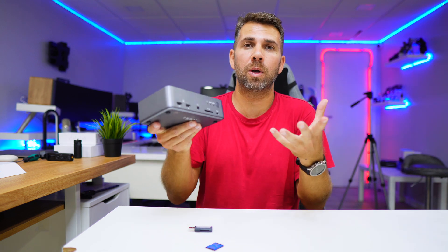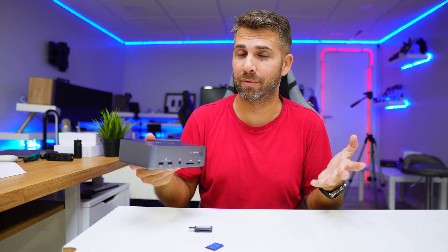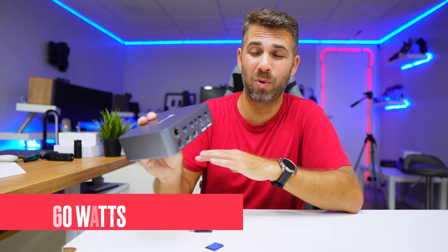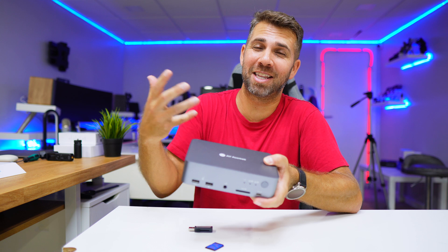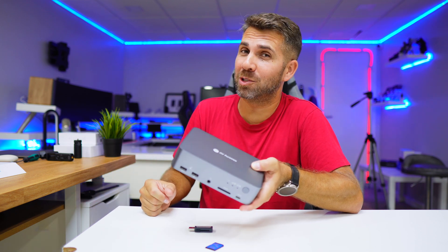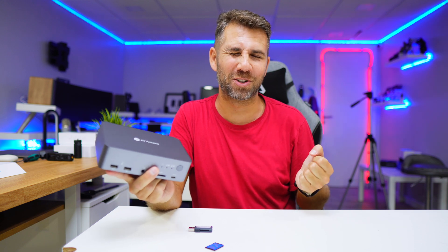You have the freedom to connect any peripheral or storage device and transfer between laptops with just one button press. This is currently the only solution I've seen that uses just one USB Type-C cable per laptop. It also charges both laptops simultaneously at up to 60W each, which is plenty for most laptops. The exception would be gaming laptops that consume more than 60W — in that case, the battery may deplete faster than it charges during intensive sessions, and you can always add the power supply as one extra cable. Hope you enjoyed the video — thumbs up appreciated. I'm Roberto George, see you in the next one.